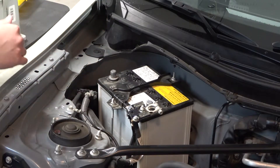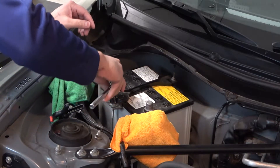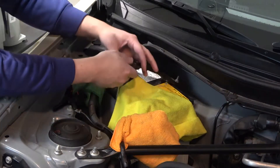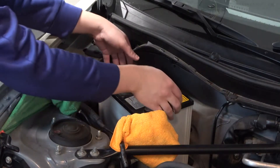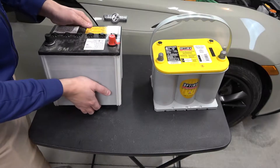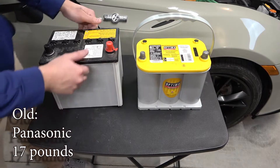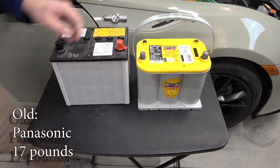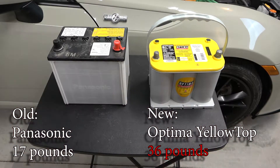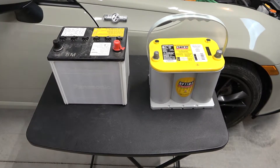Before you can remove the old one, find where your battery is secured to the walls of the bay. In the 86, we've got a metal crossbar secured with L-bolts, so remove them slowly as to not touch the terminals. Put a dry cloth over the terminals for some added security. Batteries can be super heavy at weird angles, so be careful leaning in and lifting it out. Now let's compare the two — the old battery was a Panasonic Group 35, weighing about 17 pounds. The new one is also Group 35, but with over double the weight at 36 pounds. So if you're tracking your car, you might need to look at cutting weight somewhere else to compensate for the gain.